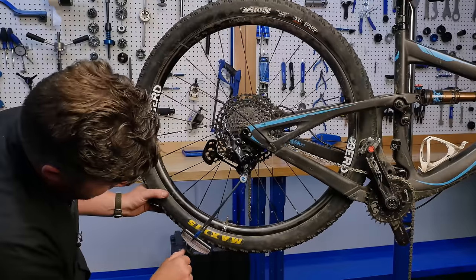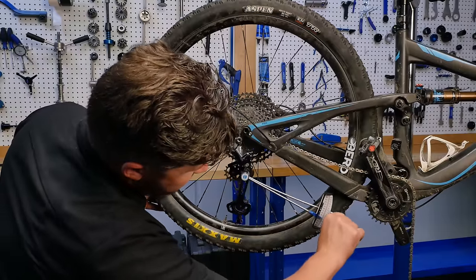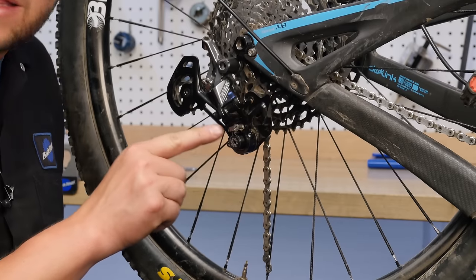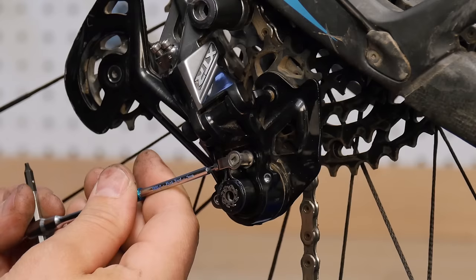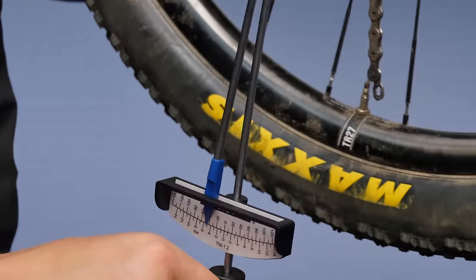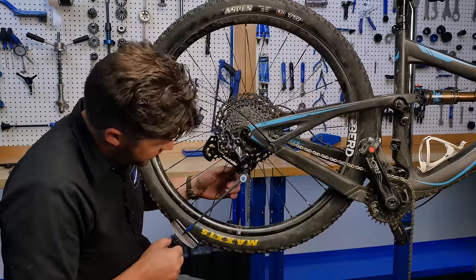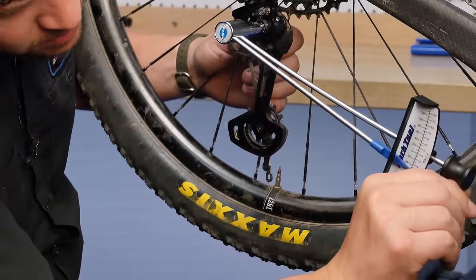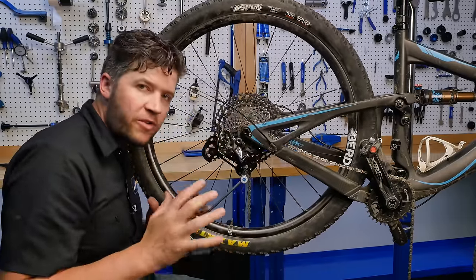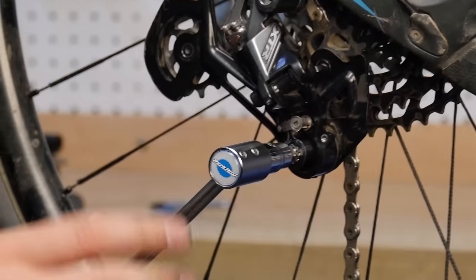So it starts out, we're at, you know, 5, 6, hits a little hiccup there, gets to 7, and we're at 8 all the way on the front end. It's a little too tight. We're gonna take a little bit of that tension off by loosening this 2 millimeter hex. Loosen it about 1/4 turn. Another 1/4 turn. The high end is right around that 5.5 Newton meter. Could be a little bit closer to 6, but I think we're a lot better than we were before. It's a lot smoother action.